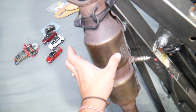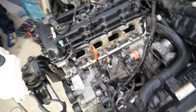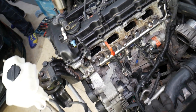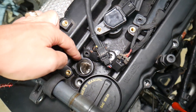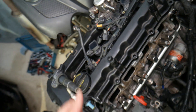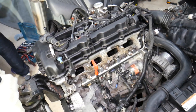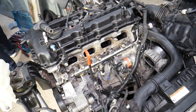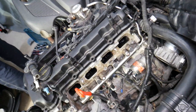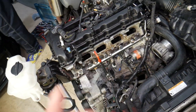In some cases, P0300 can even be caused by a plugged catalytic converter. Also, when you remove the ignition coils, check if there's engine oil in the spark plug well — that means you have a leaking valve cover gasket, which can cause misfires. You may even find water in the well if someone washed the engine previously, such as at a car dealership. Water vapor in the spark plug wells can also cause random misfires. Hopefully this video is helpful — thank you for watching and see you next time.